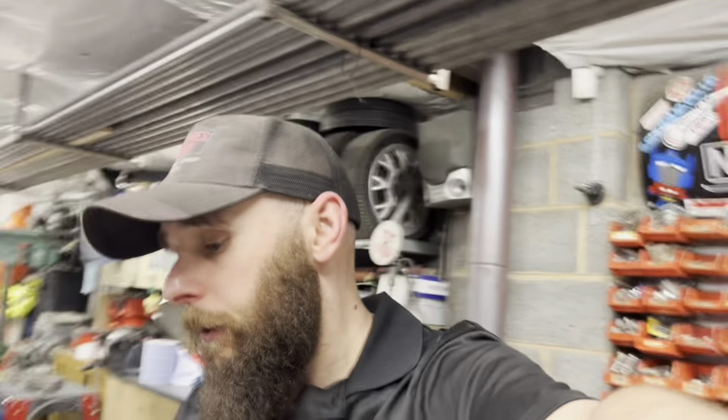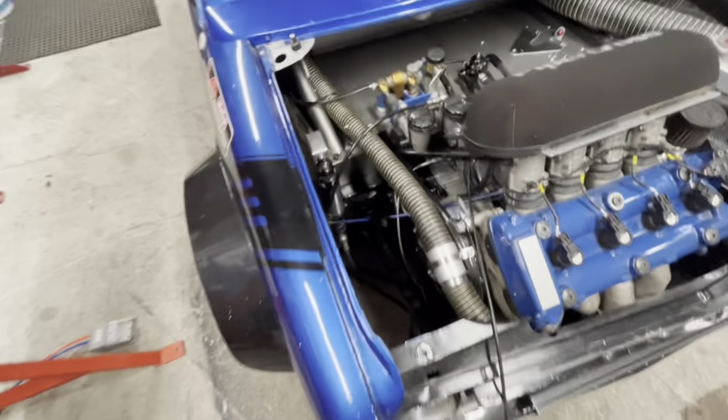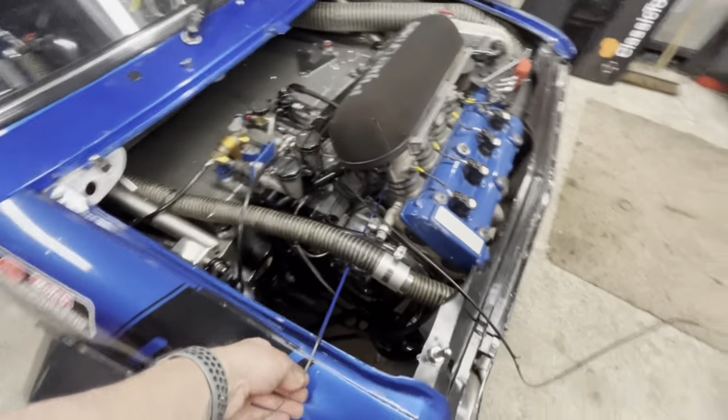What is up people and welcome back to the channel. I've whipped out these throttle cables trying to figure out what was holding the revs. It can only be a cable because there's nothing electronic that controls these throttle bodies, and if it was air getting in then it would just stay there — but it was intermittent.